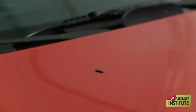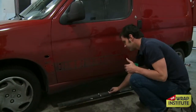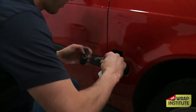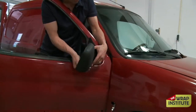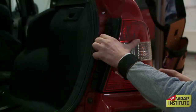Be super thorough during this process. Underneath side molding in particular is a huge amount of dirt — look how much dirt is behind there, especially on older cars. Side lights have oil, dirt, all that kind of stuff on them. Always taking the time to remove the hardware is critical beforehand — it makes cleaning easier. But if you clean before and then take the hardware off, all that dirt is going to go back on the body.